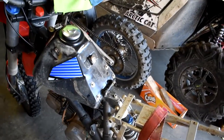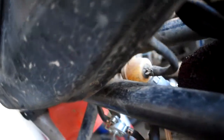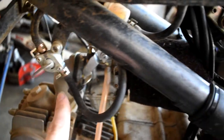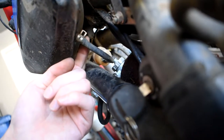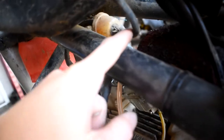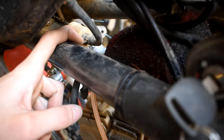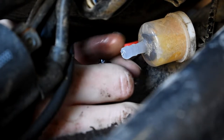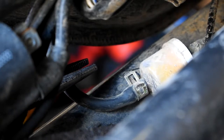Those are pulled off. Now I'm assuming my next thing to do is I'm gonna be draining the fuel tank so I can pull the tank off. This is the bottom of the fuel tank — that hose right there is what runs out to your fuel filter. From the fuel filter that comes around here, where you can turn your fuel on or off, and then that fuel line runs into your carburetor. So I'm gonna go from the bottom side of this tank right where it goes into the fuel filter — this is gonna be where I disconnect it. I'll drain the fuel right from here so there's no restrictors, not trying to flow through the filter. Then I'm just gonna put a pair of vice grips and clamp the hose off so the fuel doesn't come out.